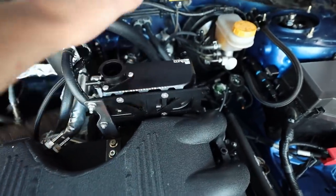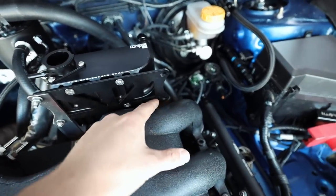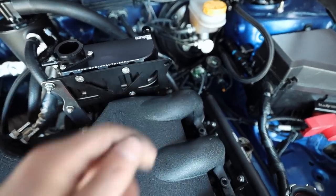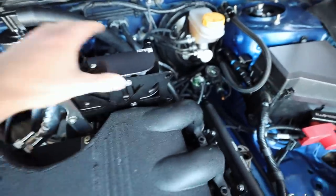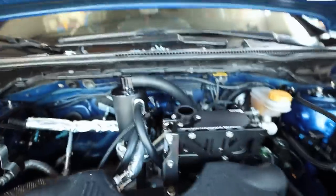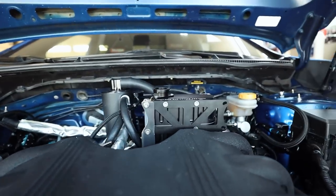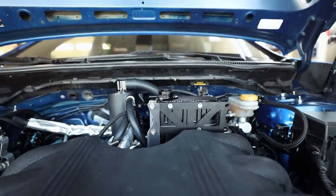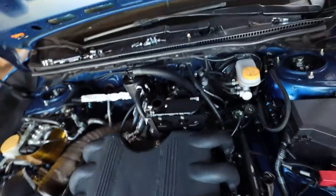So as you can see, it still shakes a little bit. So if we have one bracket that comes off here to the manifold, we'll just grind off the paint and clean it up, and then I can repaint that one section. It'll work beautifully, and it's literally higher than the AOS, just barely. They might be at the exact same level, but that'll work for bleeding the cooling system right there, and it'll work for helping with temps, maintaining and controlling everything.